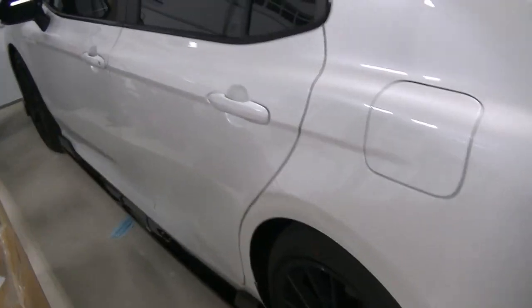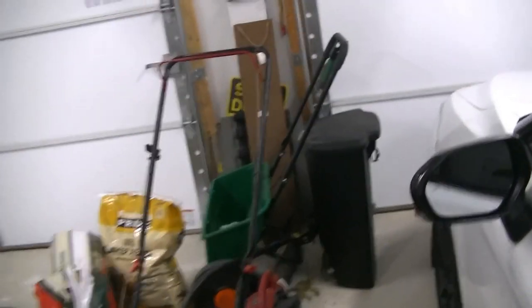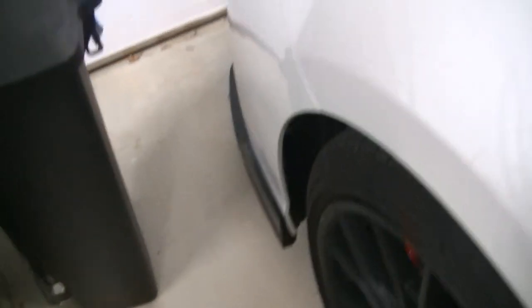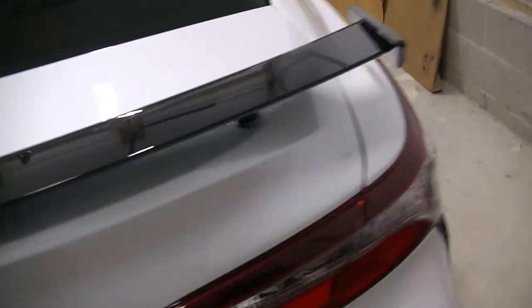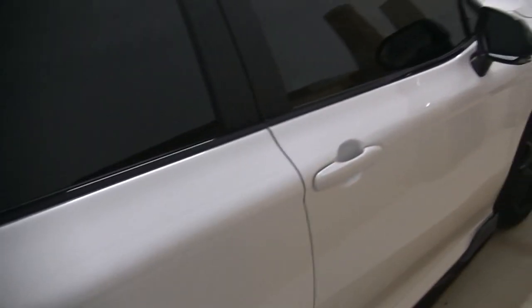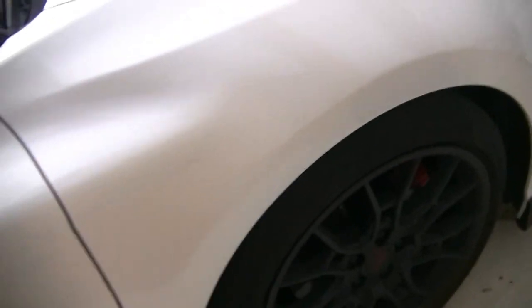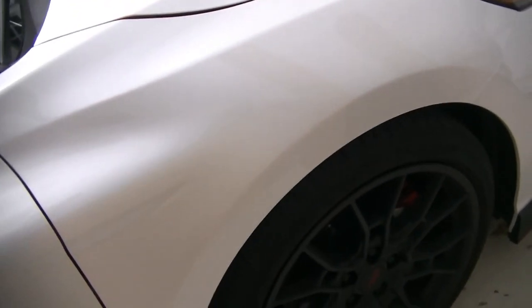The main reason that I'm doing this — there's one reason and one reason only that I want to upgrade my brakes, and that's these wheels right here. These factory brakes leave more brake dust than any car I have ever owned. It's probably because they are not a ceramic pad — they are likely a semi-metallic or possibly an organic brake pad and they just leave a lot of dust. It gets all over the side of the car and I have to clean these wheels every time I drive practically.